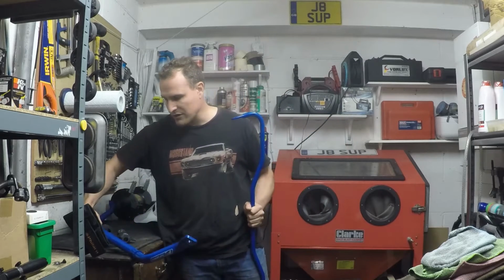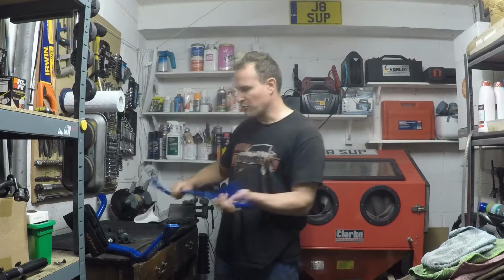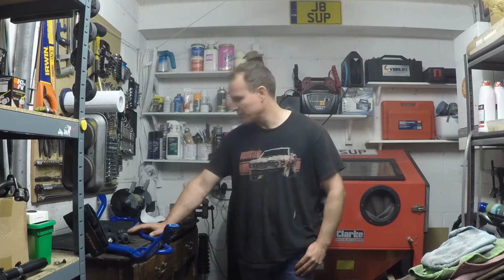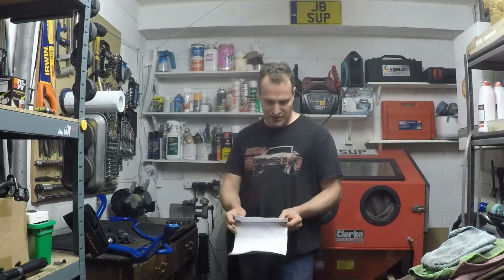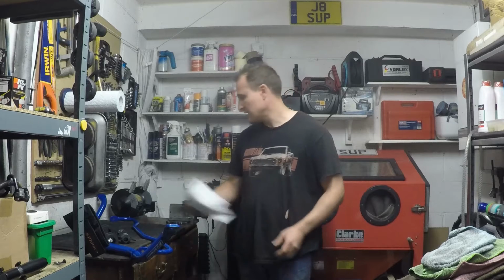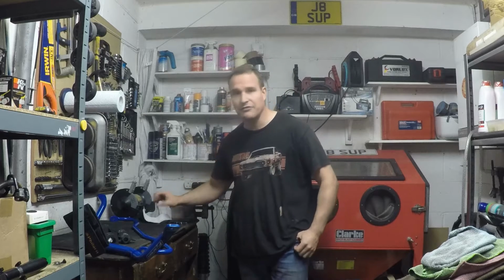I got them from America, and more on that in a second. But from all the reading that I've done, they should be fine for the GS430 because they basically share the same front and rear bars as best I can tell. The only issue you'd have is if you had one of the GSs that's got the adjustable rate sway bars, at which point this would probably be an issue. Or if you had one of the all-wheel drive models, which luckily in the UK all of ours are rear-wheel drive. Part number for this, in case anyone's interested, is PTR02-TAC-390, and hopefully they should fit fine.